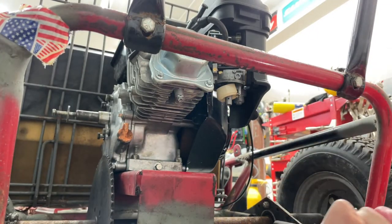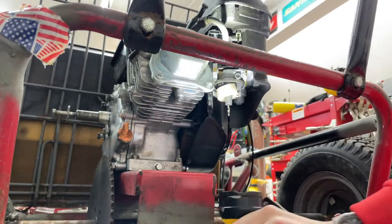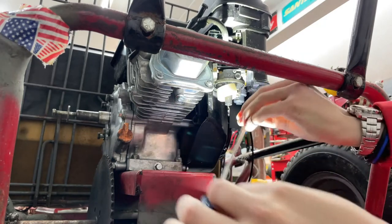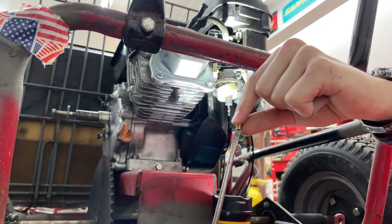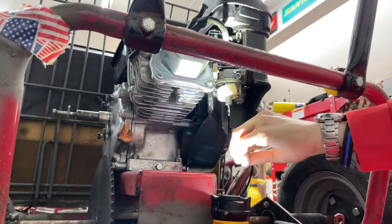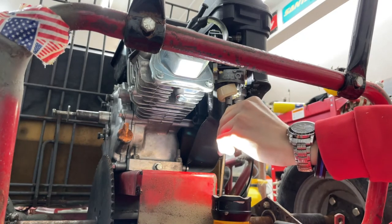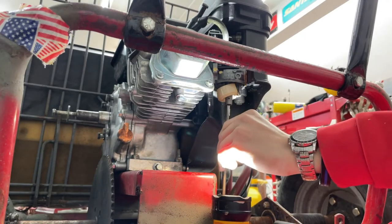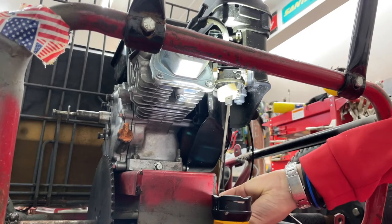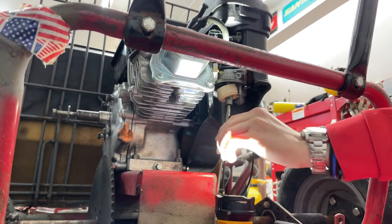I need to crawl into the cart. I have the same flathead screwdriver and a flashlight to make it easier to see, since it's difficult to see into the hole with the ceiling lights. I'm putting the jet right on the tip of the screwdriver and sliding it up in there, placing it right in the groove. I'm being careful on the first couple of threads to make sure I don't cross-thread it, because that could destroy the carb. Slowly twisting — if I feel any resistance I'll stop, but it's going smoothly. I'll snug it up just enough so it doesn't rattle its way out, and that should be good.